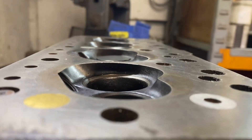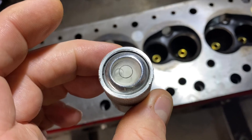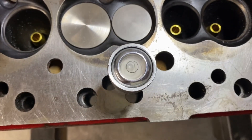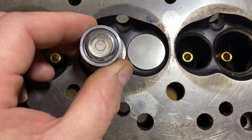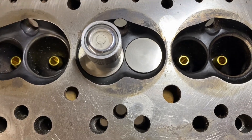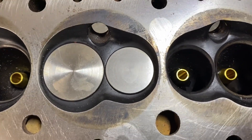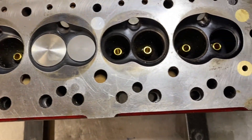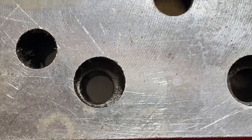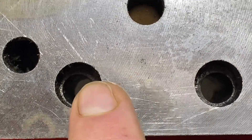It's difficult to see the incline but you might be able to see it in relation to the head face. I've got a bubble gauge here which gives you an idea that the head is reasonably flat, and then if I pop it on a valve you can see it's quite a long way over. This was done back in the 70s — this is about number 1200 from Richard Longman so it's quite an old head. You can also see that the sleeves in the pushrod holes are actually offset to make sure you've got the most amount of space for the port, and the ports aren't quite big.